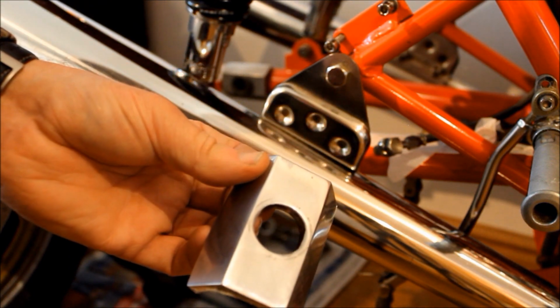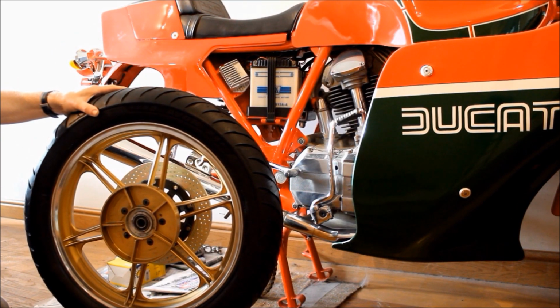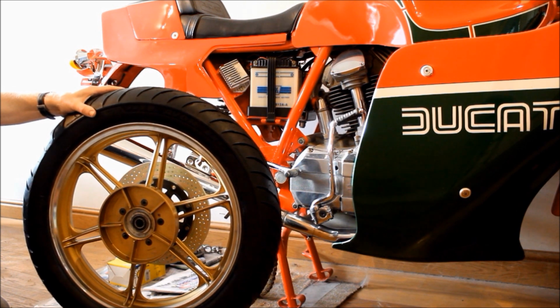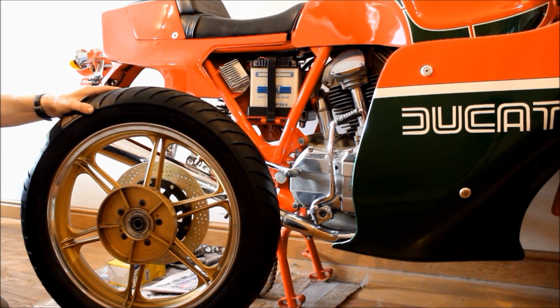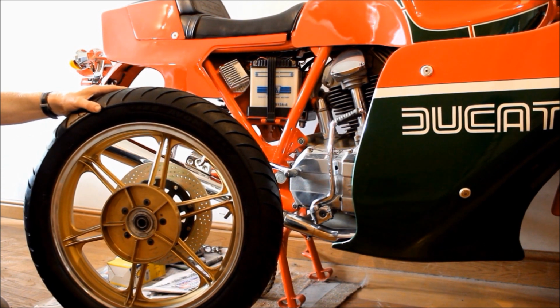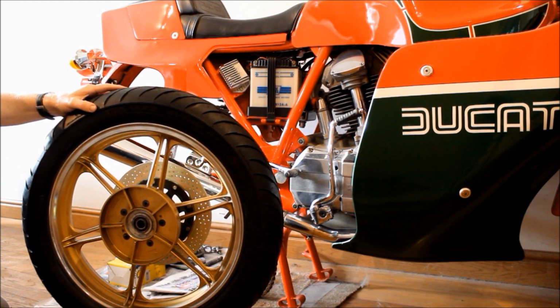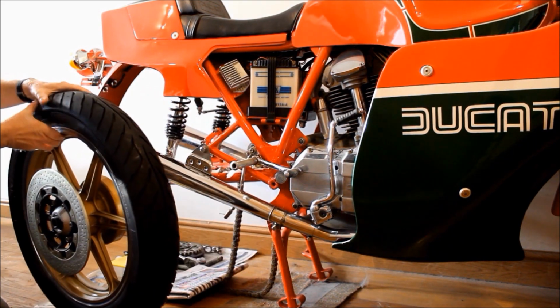Anyway, moving on then. So I've got the new rear tyre on the wheel, and that went on okay. However, getting the old tyre off this wheel was not so easy. Apparently it just wouldn't come off without a huge amount of force, and the bike shop were a bit concerned about cracking this rim. The reason being that the tyre was so old, it was hard and very difficult to remove. So in the end they had to resort to putting the whole wheel in a tyre warmer used by racers, left it in there for a few hours, warmed up the tyre, and that helped them to get that old tyre off. So that's done now, but before I refit it to the bike, I've got a couple of things to do first.